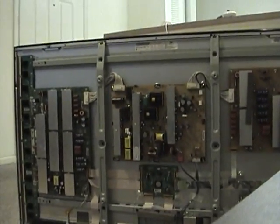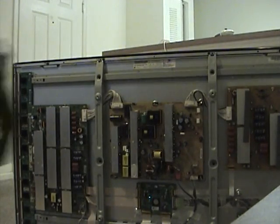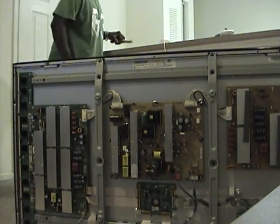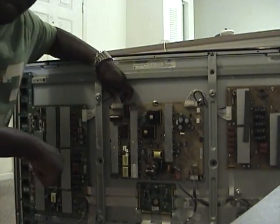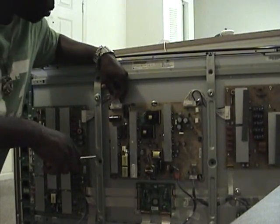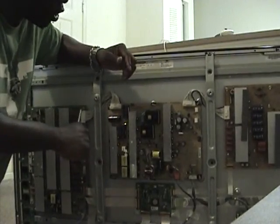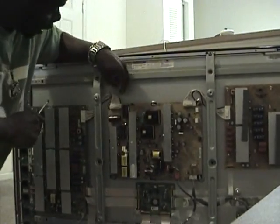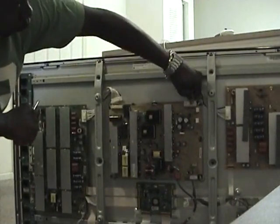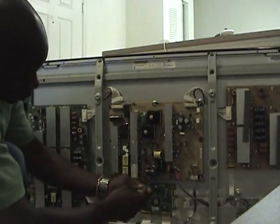I'm gonna turn it off and replace the power supply. And guys, if you haven't done this before and you want to repair it — it's a challenge. Please don't touch the part that says high voltage. Even though your TV is unplugged, these components still hold charge, so let it sit for a while before you touch any of those components. It's not a joke — I had a friend that got shocked like that.